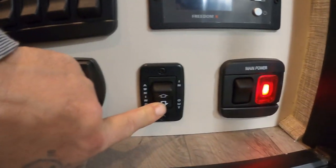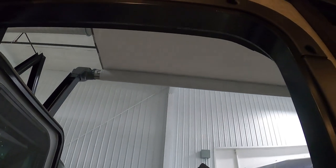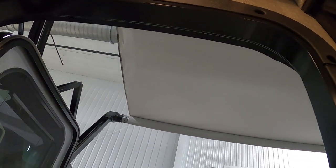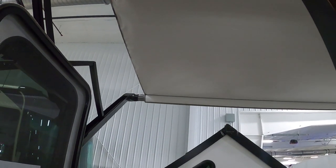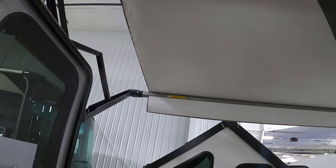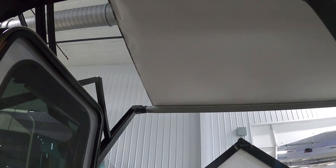Your awning — we're running this awning out. On your awning, you only want to run it out until you can see a flap fall down, and you can see the bar. If you hold your out button down, that will continue to run it out past that bar and start to run it up backwards. So just run it down to that flap — don't run it past that point. If you do, it's going to flip up onto itself. Keep an eye on it when you're running it out and make sure you don't run it further than you need to.